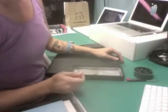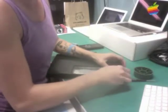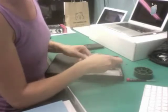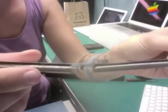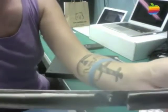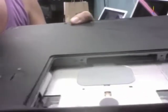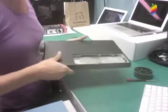First thing I'm going to do is remove the RAM shield from the inside of the MacBook. This part is actually user installable, so if you've ever been curious about how to replace the RAM or hard drive on your MacBook, this is going to be your first step. We already see the liquid in here — there's some crusty white stuff right along the metal that just should not be there. And looking into the RAM bay, there's actually brown liquid right along the edge there. So we know we're going to be getting to some good stuff in here.